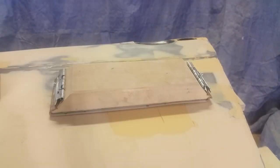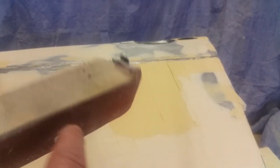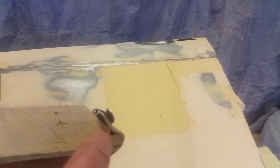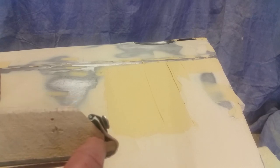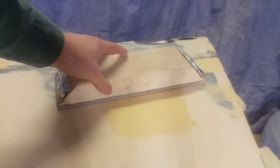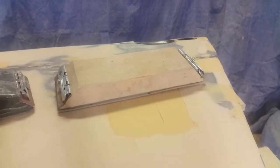So I got down a two by four equivalent and made this. I took another sander apart and got the clips — really very simple. I just cut a profile on the miter saw and trimmed it down to the same size as the other one on the table saw, then rounded off the corners on top so it'd be nice to handle. It works really well — gives a nice flat surface instead of having the tendency to dip into the corners and shallow spots.